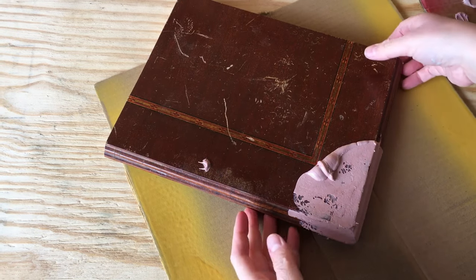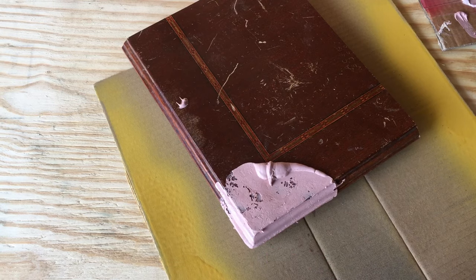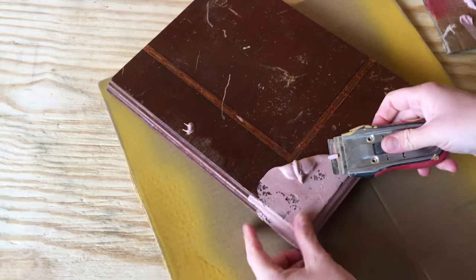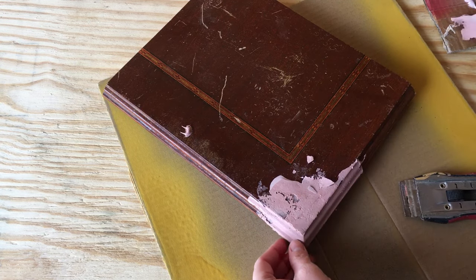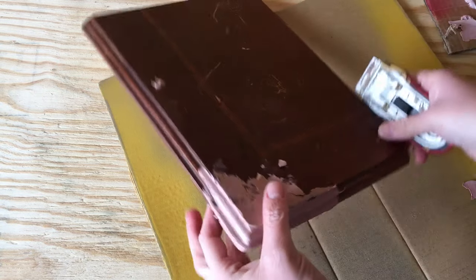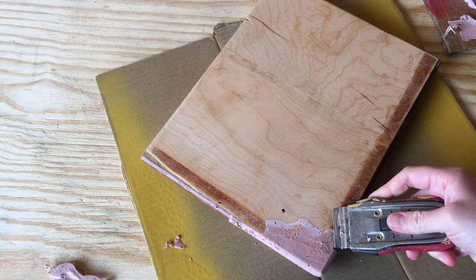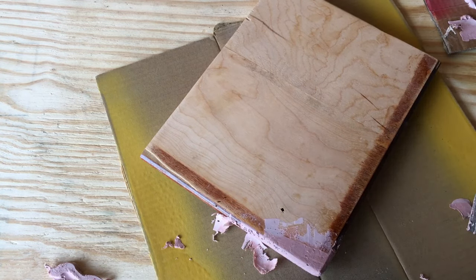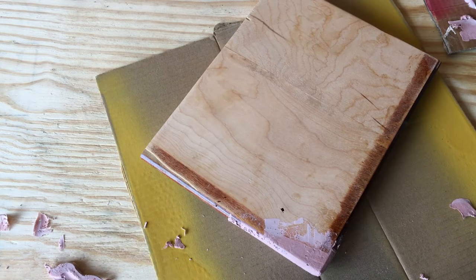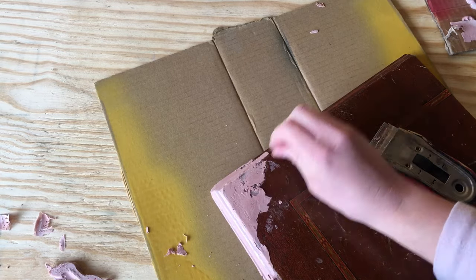Once it has started to harden, you can remove the hot glue mold. The Bondo will then continue to cure — it takes about 30 minutes to really harden. Before it hardens all the way, here's a little trick: grab your utility knife or something with a sharp blade and remove the big clumps of Bondo. Don't get too close to the edge of your repair — just remove the main excess so you don't have to sand it all down later. Scrape it off before it really hardens, because once it's fully hard you won't be able to cut through it with a utility knife.